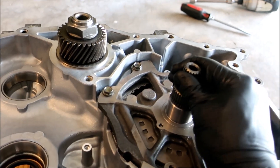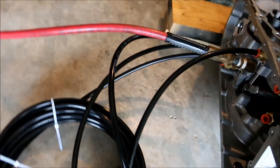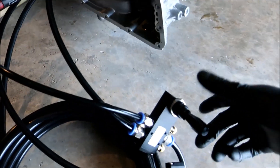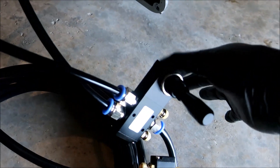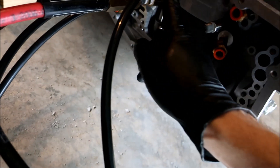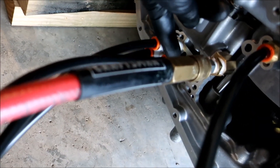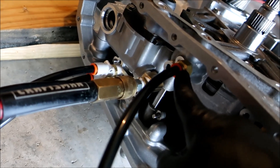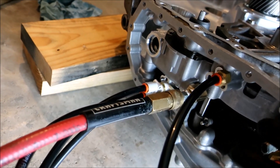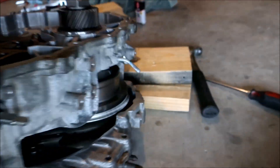I'll shoot a video of the primary and secondary pulleys actually moving. I have the connections for the variable diameter pulleys - the primary and secondary pulley. Here's my input coming in, goes through the oil pump, then this line is going to be the input to this control valve. Whenever I move this it's going to control air pressure onto one side of the pulley. That other line goes to the secondary pulley and this port goes to the primary pulley. In reality the system has pressures on both sides of the pulleys to control how much clamping force there is on the belt.